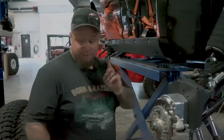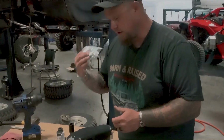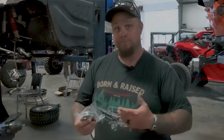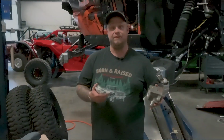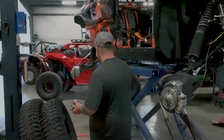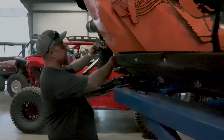And then the fun part. What I wound up doing was I bought an alternator kit. It is an external alternator, ran off a belt from the motor. That way, I don't know, lights, whatever crazy things you want to do there. But we're not going to run an alternator there. We're going to run a PSC full hydro pump where the alternator is supposed to sit. So the plan and the goal is for us to install this on the side of the engine. About right here is where this pulley mounts, and then it comes with brackets and everything.